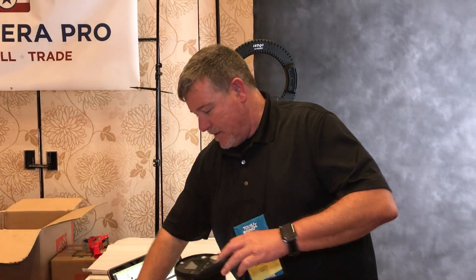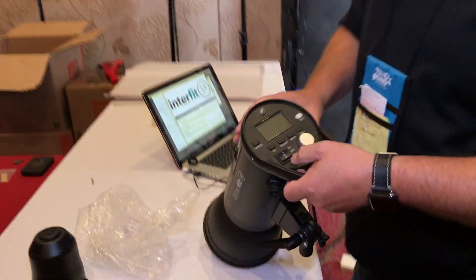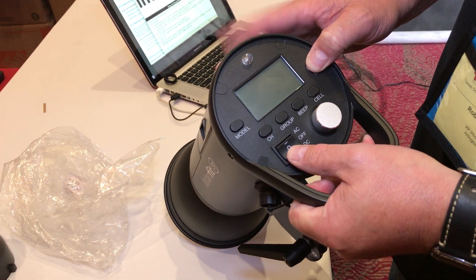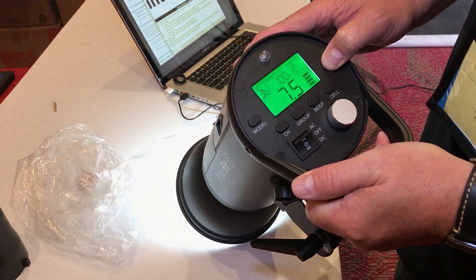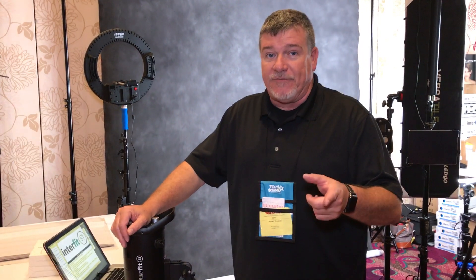Just put your knob back on. If you like, you can take your battery and put it back in. To find out what your firmware is, hold down the test button while you turn the unit on, and that will show you 2.3 — that is the current firmware this is loaded up with. And there you go, that's how you update the firmware on the S1. We're getting all of these updated — if you're in Tulsa, Oklahoma City, or Bedford, we'll be updating those firmware as well.